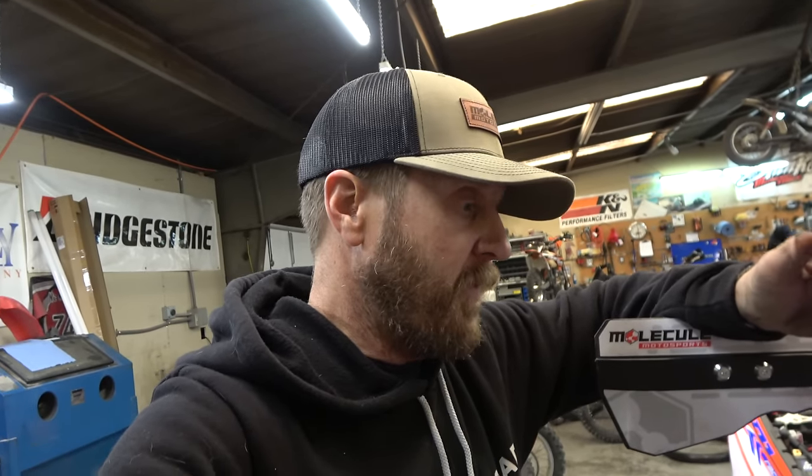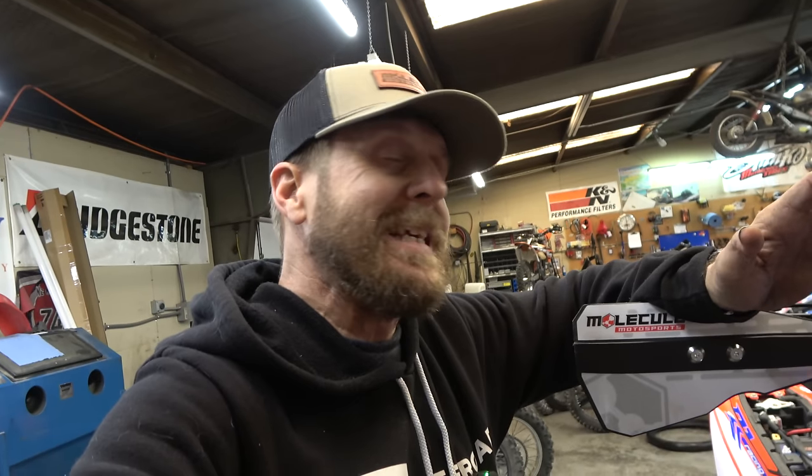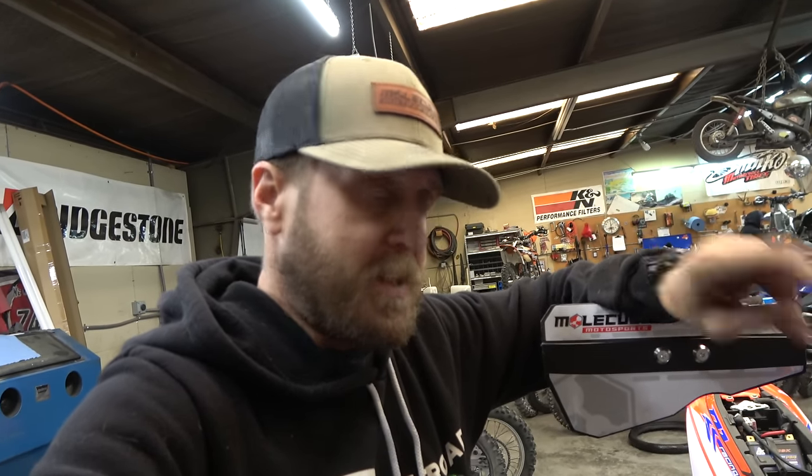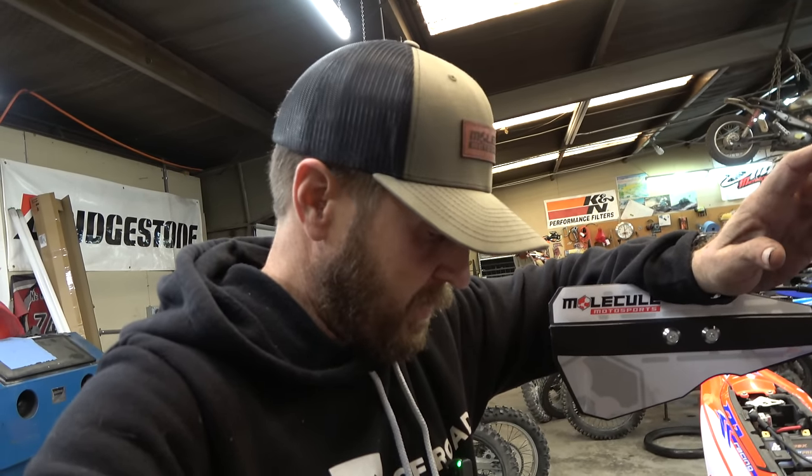I got the carburetor jetted. I'm running with the jetting, or close to the same jetting, as my good friend Lane, the Arkansas Assassin, which works really, really well. I've got a 158 main jet, a 40 pilot, and the NECJ needle in the number two position. So we'll see how that runs. It should run perfectly, because that's how Lane's is jetted.